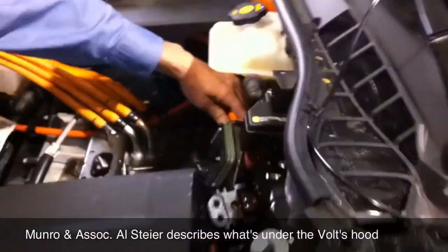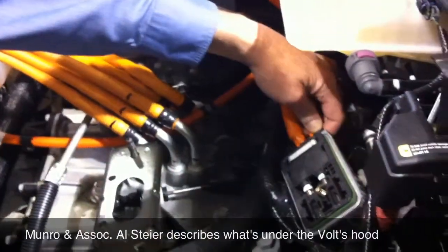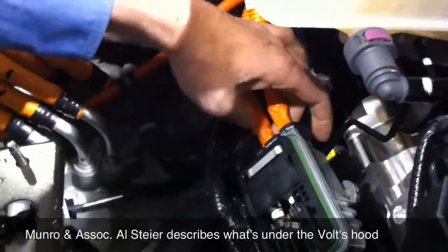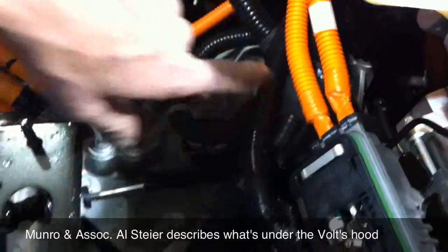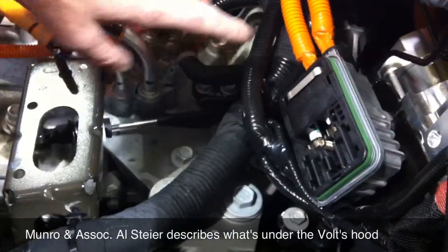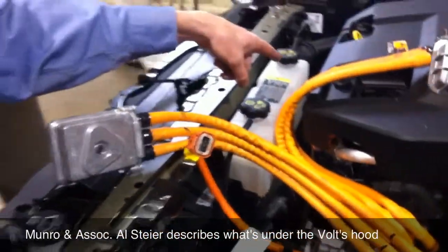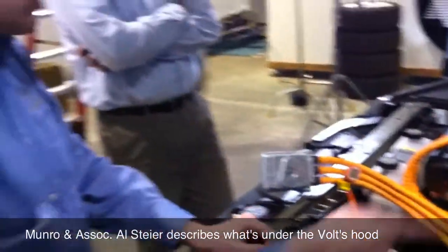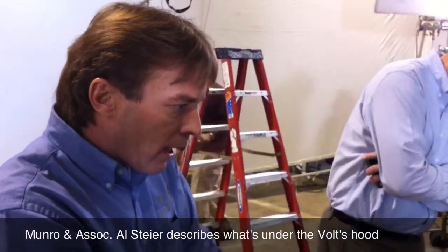There's this big connector down here. It's got a couple of double leads coming out of it. It looks like it's a power-ground split — that's why there's one going each way. So they actually spliced this inside of here. One of them is probably feeding the AC down below; the other one is most likely going back to the AC charge module.